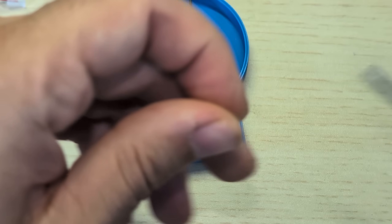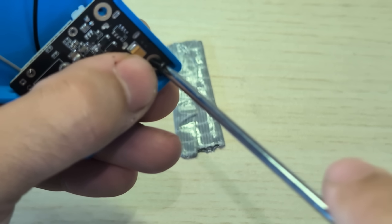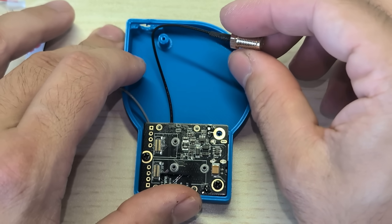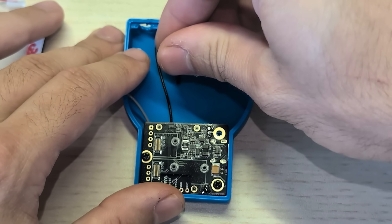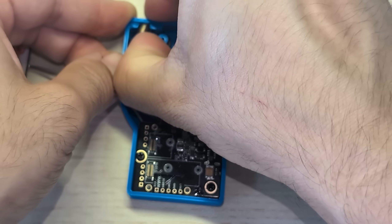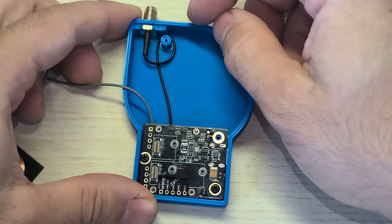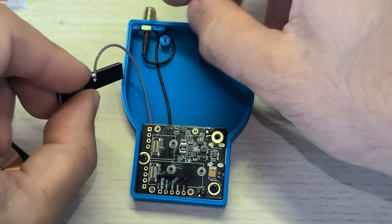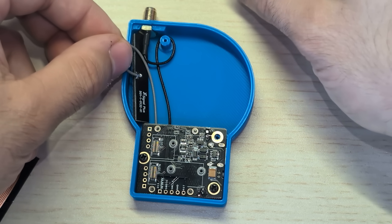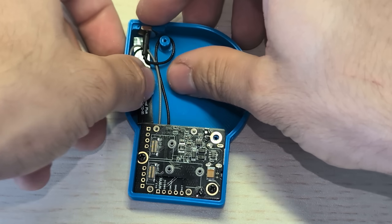Optionally — it's not really necessary, but because these are for a customer, I'm going to do it properly — I'm going to put the second one in this hole here. So now we have to arrange these antenna wires. You're going to take the SMA antenna wire and wrap it around that screw post and then just loop it back and slide it right into the hole here. It's going to pop right into that, holding the SMA connector in place. What I like to do is put the antenna like that, then making sure that the gray wire goes under the black one, lie it flat.